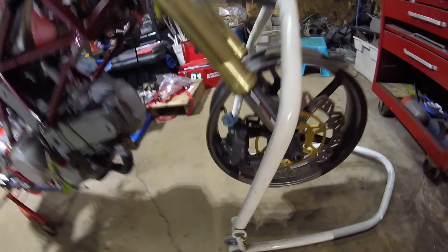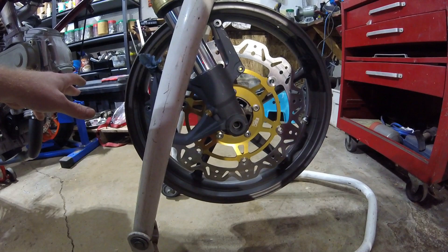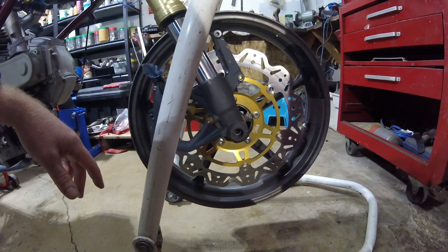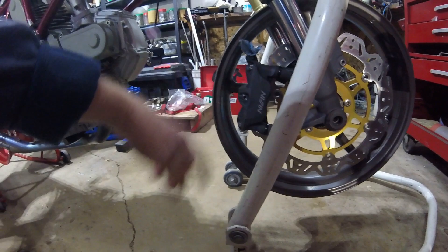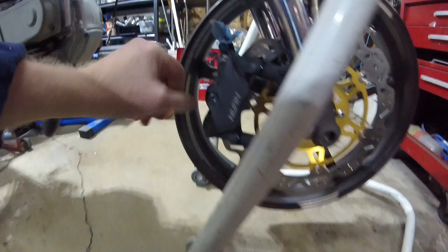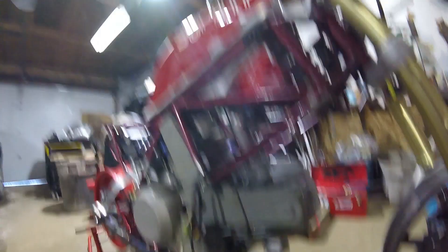The front brake solution uses the 675 wheel with an aftermarket rotor — it was $100 and normally comes in pairs, but the seller was just clearing out warehouse stock. I used titanium 12-point caliper bolts I had lying around plus a small spacer. I did wonder if I needed the spacers, but without them the top of the caliper fouls on the rotor. Originally the setup was 300mm rotors; these are 320s or 310s, so some spacing is needed.